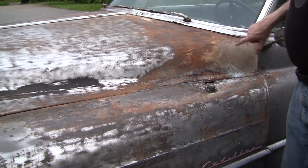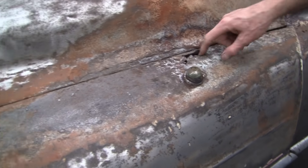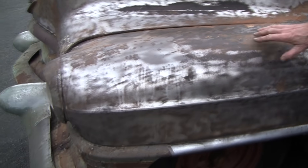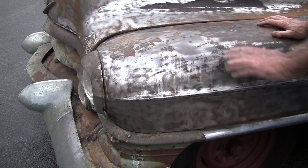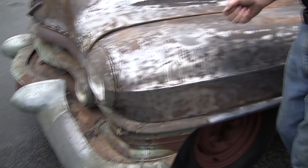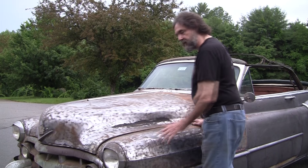We're going to have to replace part of the rear of this hood and part of this fender right here — it's just too rusted. As you can see, there are perforations here. On this lip over here, it's all gone, so that has to be fixed. But as you strip the paint and the surface rust off with the naval jelly, and also with the phosphoric acid — we used a spray of that after to clean up after the naval jelly with steel wool — when you let it set, you can see all the flaws.